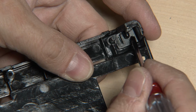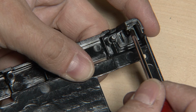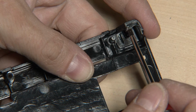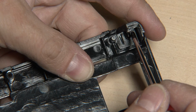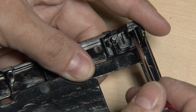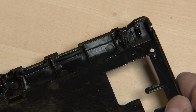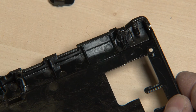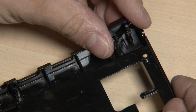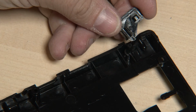This is just trying to find the perfect sweet spot to make them feel good. The spring already improves everything because it automatically moves up again, but it still needs to have that exact sweet spot to feel good. But the first important thing, of course, is that this is able to push the button at all. As long as it cannot push the button because it moves up and down, it won't work. After that, of course, the second shoulder button needs to be fit or fixed. And it needs to be fixed so that it cannot move up and down.